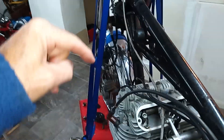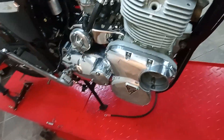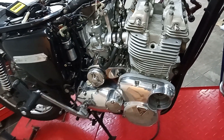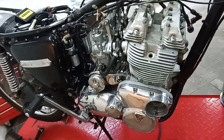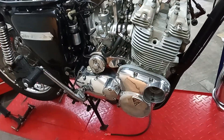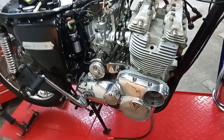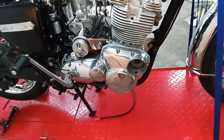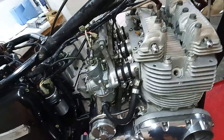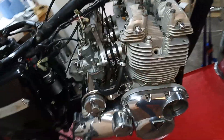There's always confusion because you sit on the bike and think it's obviously one, two, three from this side — but the convention is that number one is always next to the timing side. I should mention that Jaguar E-Types went the opposite way to every convention on their straight-six, so you've got to be careful. But generally speaking, certainly on old bikes like this, number one is on the timing side, two in the middle, and three on the drive side.